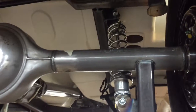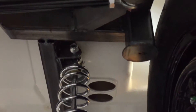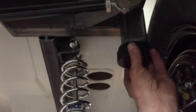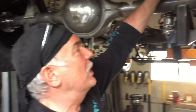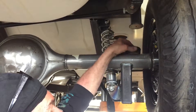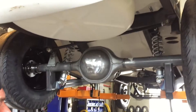All the steel work is cut and tacked in place. These are actually mounts — I use hockey pucks as suspension stops. They'll have a recessed screw and be bonded on. What that achieves is: if the car should bottom out, the rear end will actually hit this dense rubber material rather than bottoming out the shock or hitting the tire on the fender. So it's actually a bump stop. The front has the same thing.